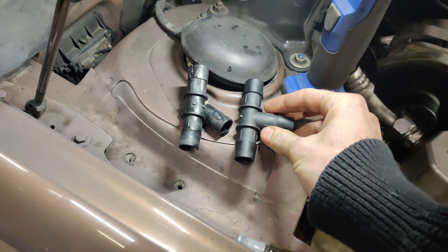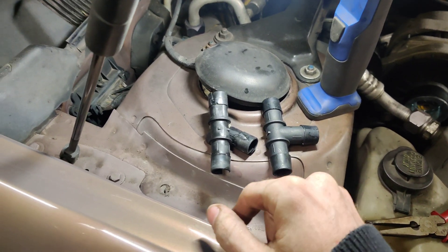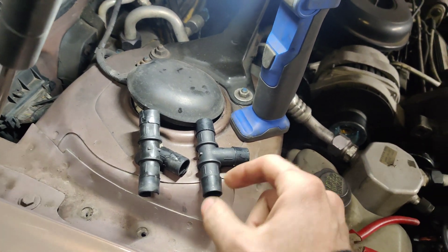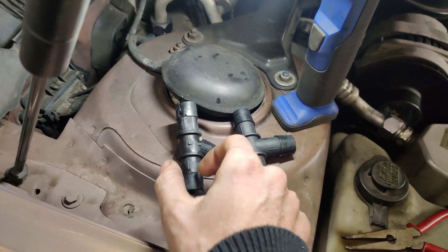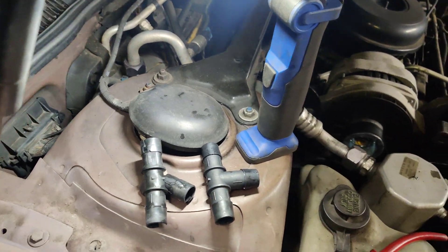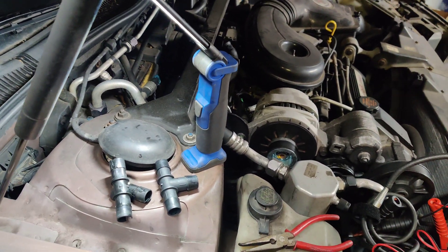Okay guys, here's our new coolant tee. This one's made a lot heavier. Now to measure these — when I measured the opening right here, it's 5/8ths. This is a 3/4 inch tee. You've got to measure the edge of the flared section right here. Because when I measured it on this one, it was 3/4, but the inside was 5/8ths. So this is going to be our tee for this. I'm going to get this put in, then we'll turn our smoke machine back on and we'll pressure test it and see if we have any leaks.